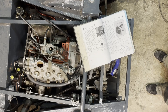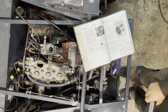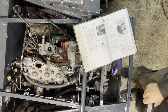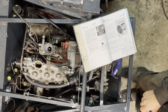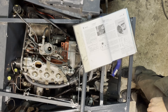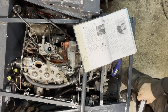When I put the cylinder head onto the engine block I tighten down with only 30 newton meters, and after that I will now turn every bolt 90 degrees further. Then after some warm driving I will tighten down another 20 degrees, two times. But now 90 degrees in the special order.